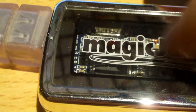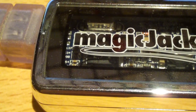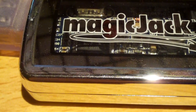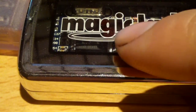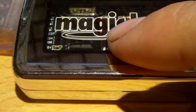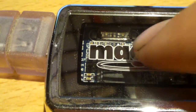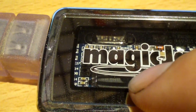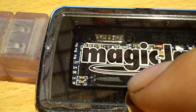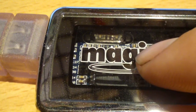Windows sees this guy as 'USB Internet Phone by Tigerjet.' Basically, a MagicJack has, let's say, a mini sound card. The way this works is it acts as an audio adapter for your telephone to work with your computer, and the MagicJack software on your computer does the rest of the work. I believe this microcontroller also emits the dial tone that you hear when you pick up the phone, and it's able to interpret tones from your phone when you're dialing numbers.